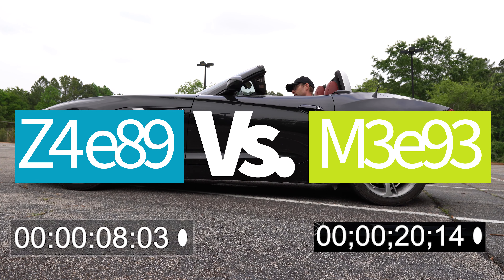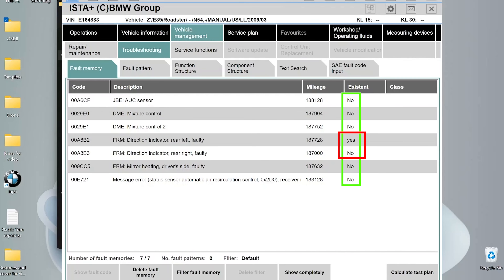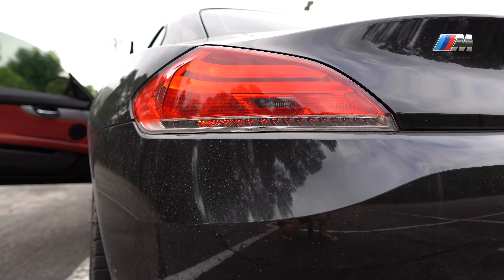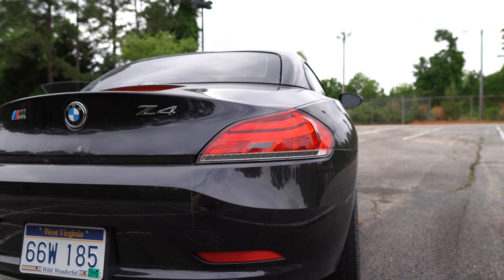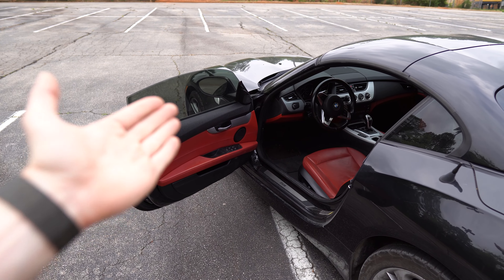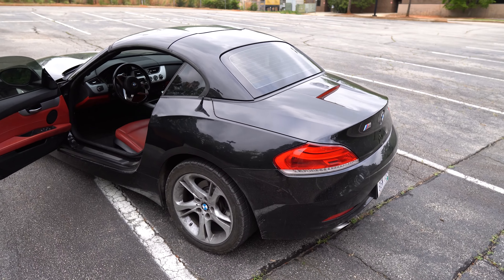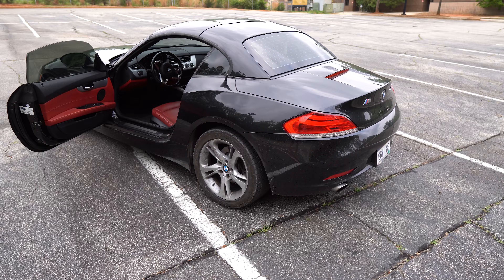Getting into the diagnostics, there are only seven fault messages. The faults are for the direction indicators — rear left and rear right. The left one is not working correctly and the right one is also popping out, so we're going to disassemble the signal and see what's going on. One message is for mixture control, which sounds like the car is already catless — as you've seen, we had the downpipes in the trunk and it sounds like they're not installed.